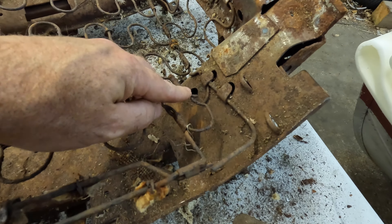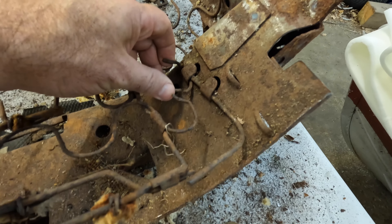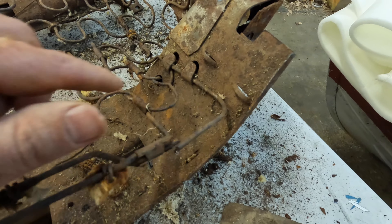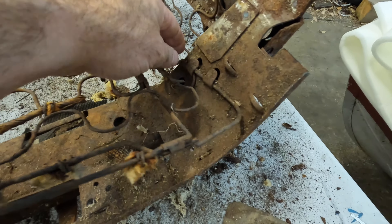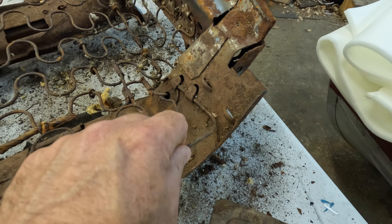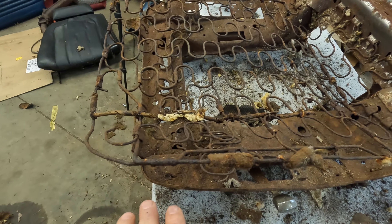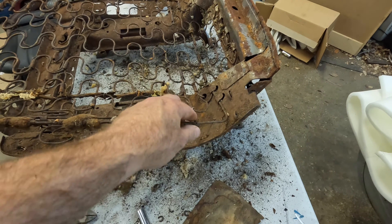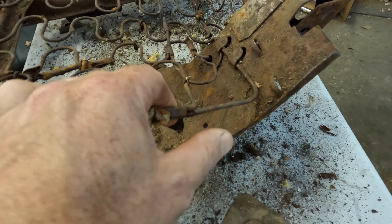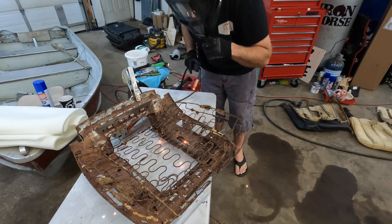The spring on the outside is completely broken, so I'm going to try and weld those two together and clean this up. These inner springs are broken too, so I'm going to try and weld this tab back on if I can. This outside one will really help stiffen this seat up a little bit and stop me from leaning over to one side. Hopefully I can get it on this thick part right here and just weld these two pieces together so that stays solid.